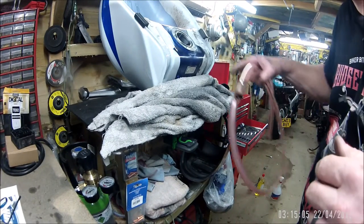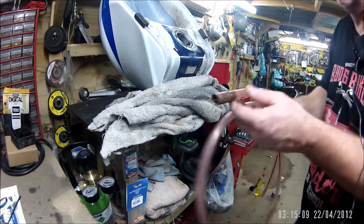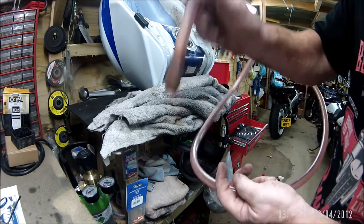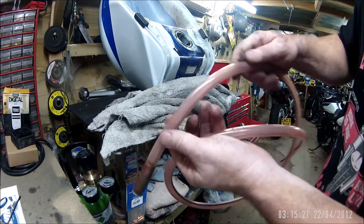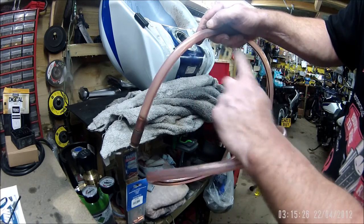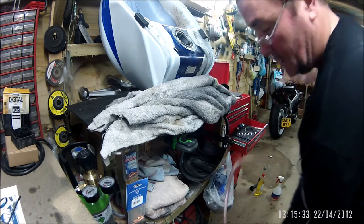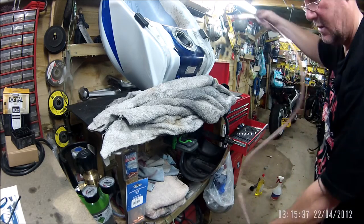And if you were wondering what I use, it's a bit of pipe with a one-way valve. So you pump it up and down and up and down, and the fuel gets in but can't get out. And eventually it gets over whatever curve you've got in it, and then gravity takes hold and away it goes. I think actually it's going to be good enough on the floor.